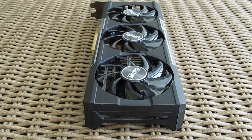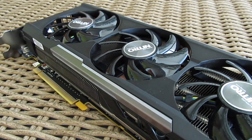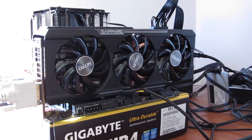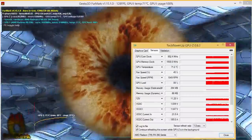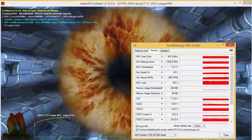As for the cooling performance, it seems that Sapphire did a rehaul of the firmware and BIOS in regards to fan control, and now the card can work completely passively under idle. If it gets a bit warmer — above 47 degrees Celsius — the fans gradually turn on one by one depending on how hot the card gets. From our experience, the card utilizes zero to one working fan at idle, which is in practice inaudible. Under load it can get up to a pretty low 70 degrees Celsius thanks to Sapphire's Tri-X cooler, while all three fans in that case produce a decent but bearable noise.